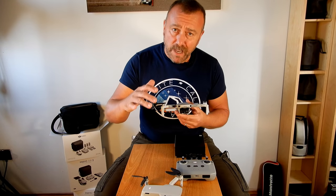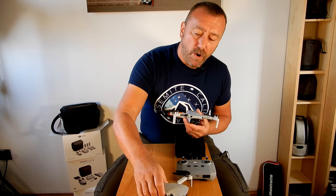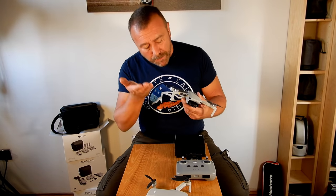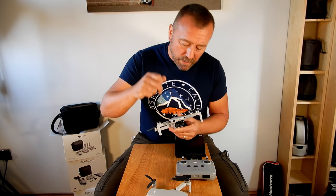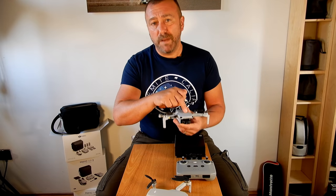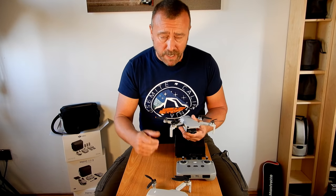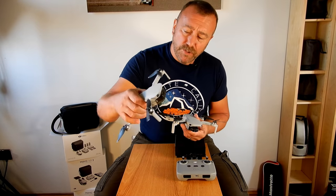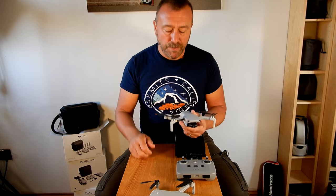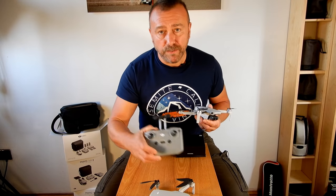Camera - pretty much the same. You used to get 12 megapixel photos. The sensor was capable of shooting 4K, but obviously the processors inside couldn't handle it for whatever reason. They've clearly upped the processing power because you've now got 4K. You've still got the 12 megapixel photo ability. You've got a higher video bitrate - 100 megabits per second. That's the amount of information in the video itself. The original Mini was limited to just 40 megabits per second, so that's a two and a half times increase in the video bitrate.